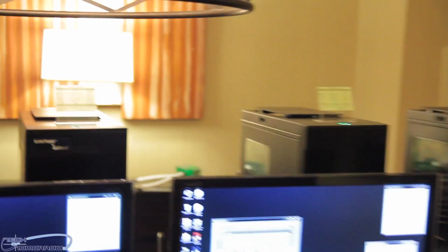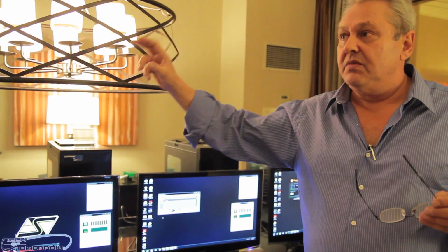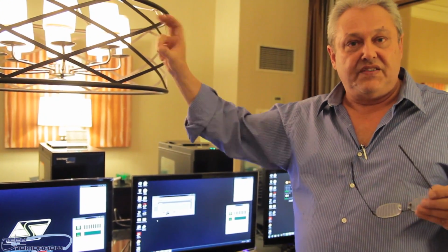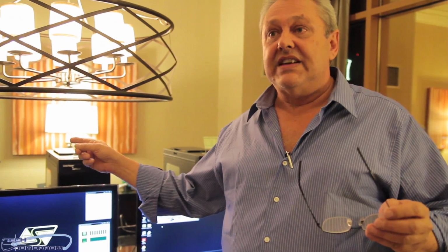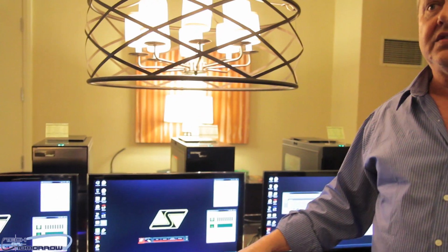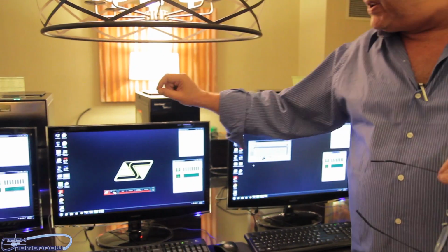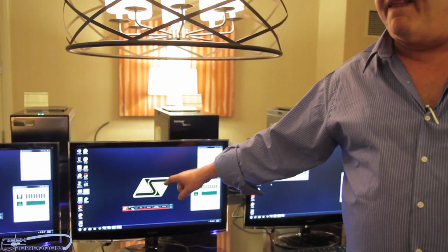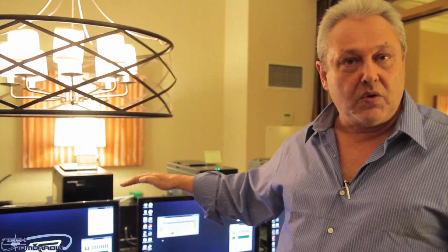Now, conditions of this test. We want to be able to read the temperatures and see approximately what the temperature differences are. Oh, I forgot about the CPU, sorry. Core i7 3770, overclocked at 4.6 gigahertz. Intel processor, obviously. All these machines are overclocked by the push of a button thanks to the ASUS software. We did not tweak the voltage or anything like this. Just push the button, 4.6 gigs, all four of them, so that we are on equal ground with respect to the thermal load.